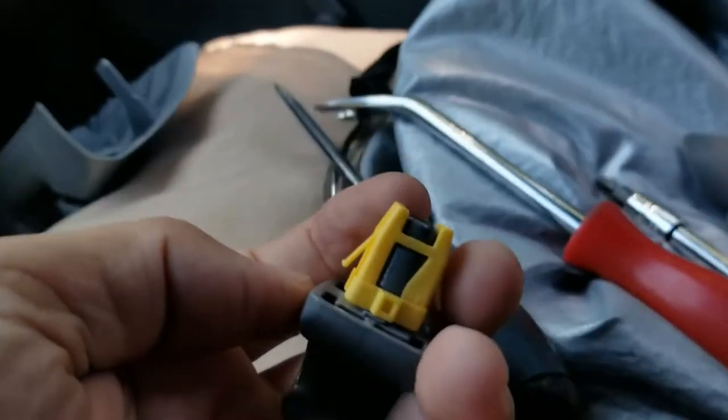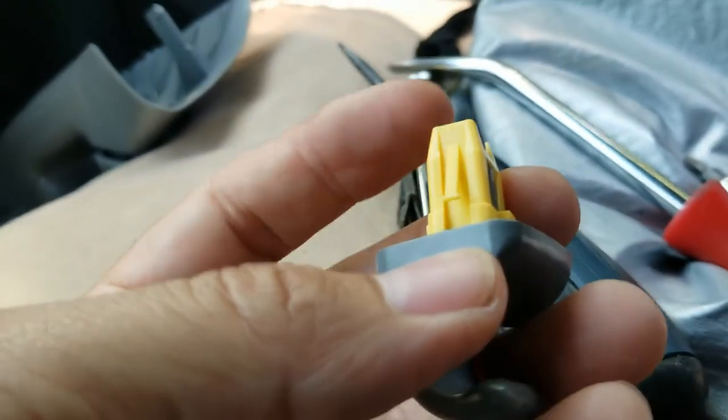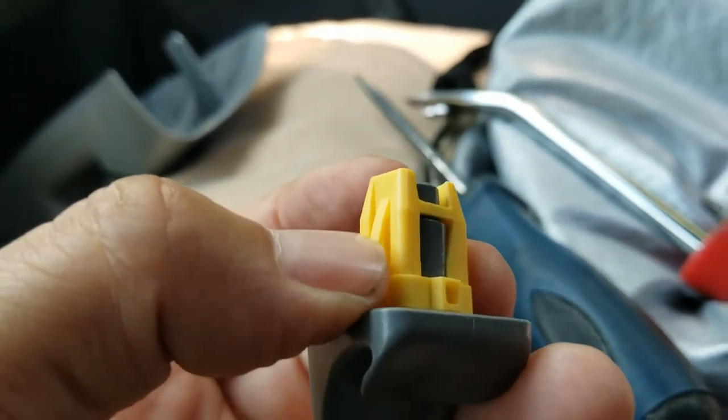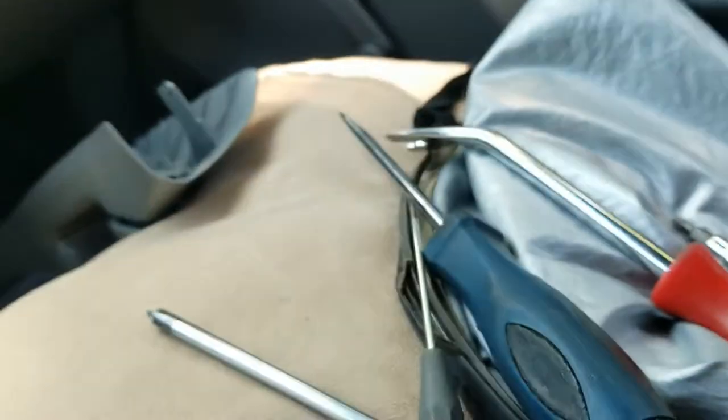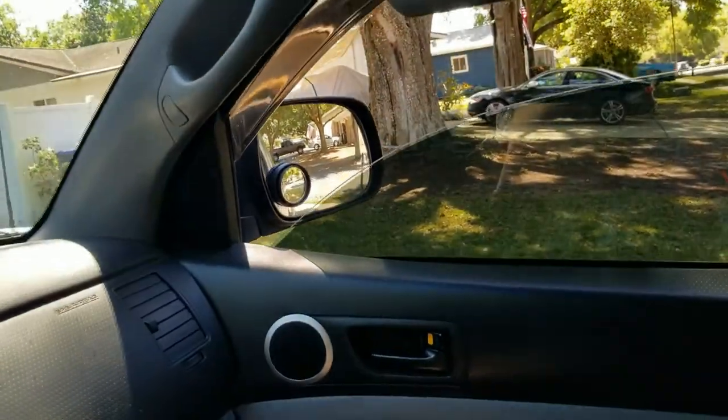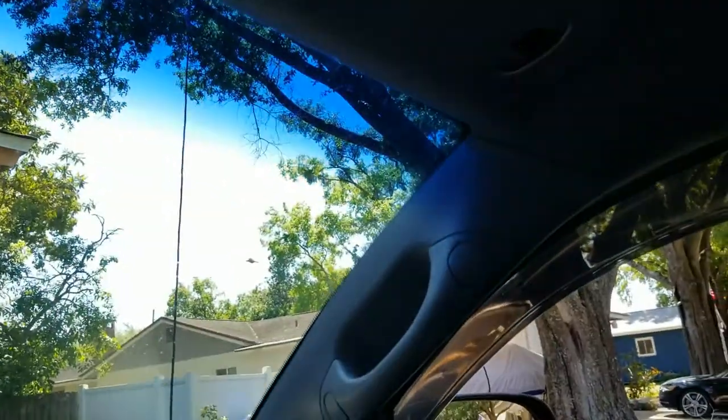See, this is what it looks like. I've removed this — this is the one on the driver's side. Right now, what's holding the clip to the headliner is this little thing over here, but the headliner itself is loose on this side. On the other side, for the visor, just Phillips screws — two Phillips screws. And it comes right out.